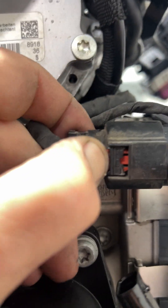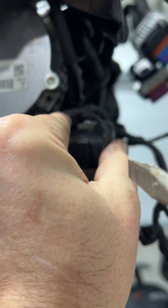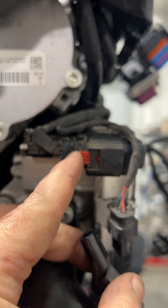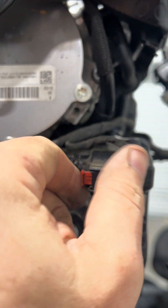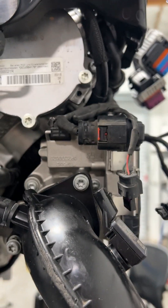You just gently apply pressure - maybe five to ten pounds of force - push back and just gently slide off, and that releases them. There are also some connector pliers out there that make it quite a bit easier to disconnect these connectors. Going back together - connector seated - now it's seated. If it's not fully seated, this secondary lock won't go into place. You don't want to force anything; as soon as you start trying to force things on these connectors, they break really easily.